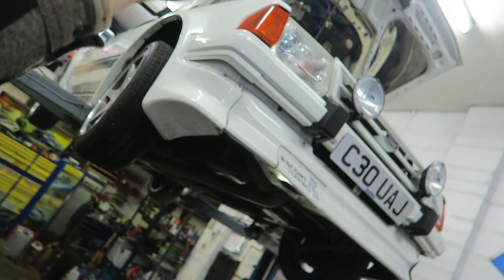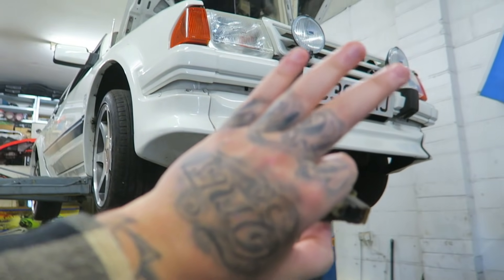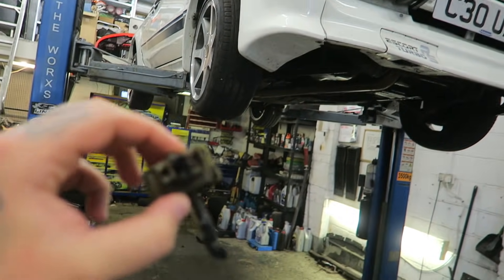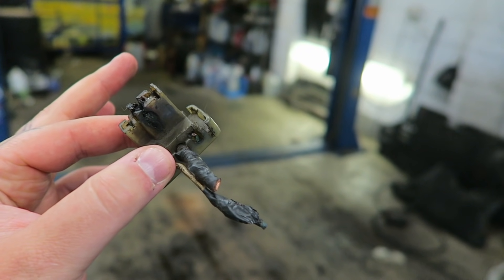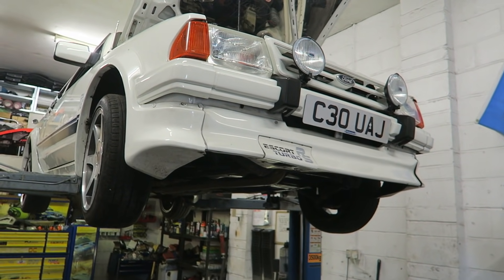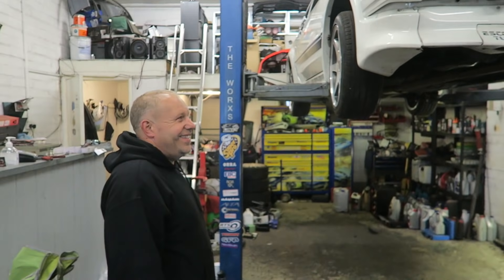The initial thing was to service the alternator, because it was on its way out. The last time I drove it the warning light came on — that was the issue. Now, I'm not saying anything bad about previous owners, but this is an old car and at one point they were worth absolutely nothing, so people just jimmied whatever they could in there. This is what was on the back of the alternator — that plug is not happy. So we've rewired all that, the alternator is on, it's charging nicely, no lights, not draining power from the car, which is fantastic.